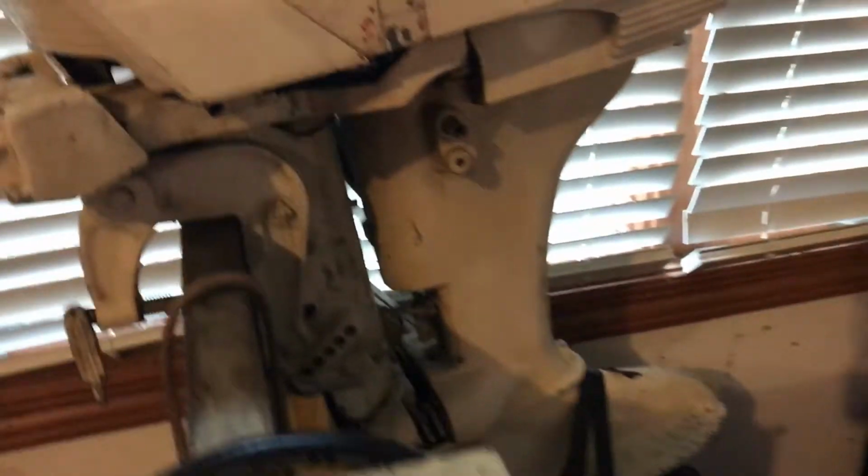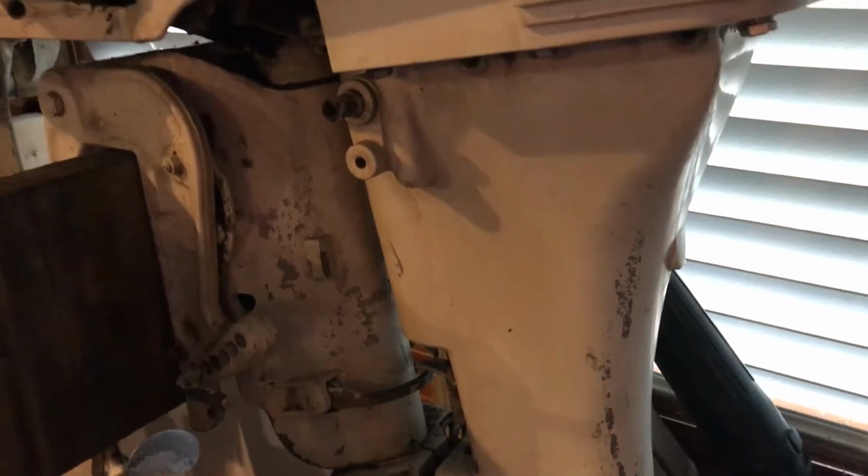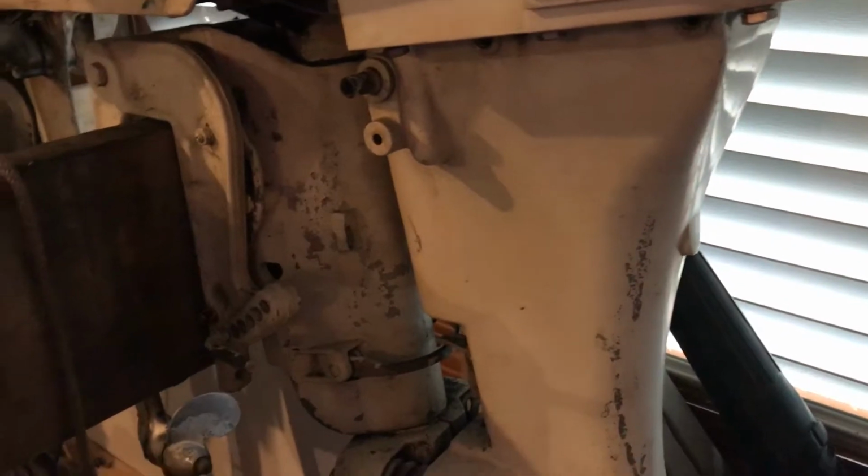But everything's back together. It does run. And a little thing on this life support we had going on: it's just a tube that goes up to the water tube that goes up to the power head. Basically it runs some water through this upper pump here, so it doesn't fry up, and also keeps it cool. We weren't running it very long, just to see if it would run. This drive shaft was wiggling all around, which is not good for it, but we just wanted to see if the power head was still good.